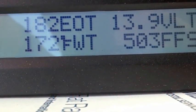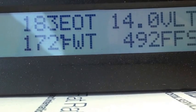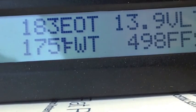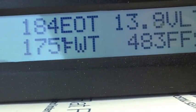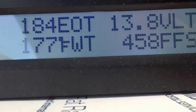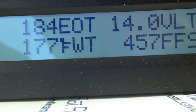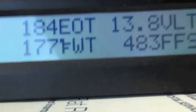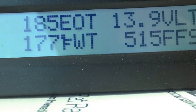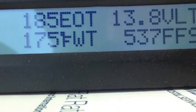At lower speeds, going stop to stop, you can see the temperatures get closer together. To do an accurate test, you need to get it out on the highway and open it up. With newer oil coolers, I'm only seeing maybe three to six degrees difference, even towing in the middle of summer where it can be 120 degrees outside. Make sure you set your scan gauge up and monitor correctly to see how RPM affects it.